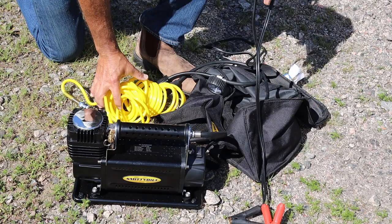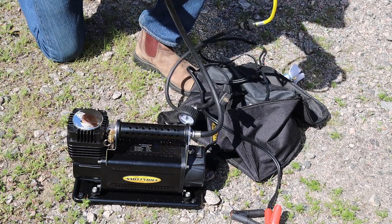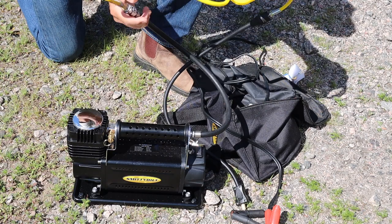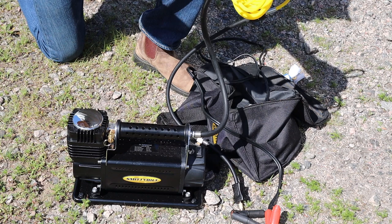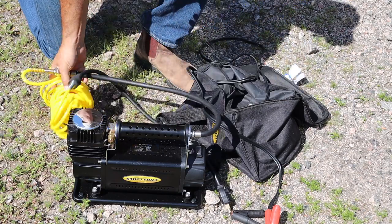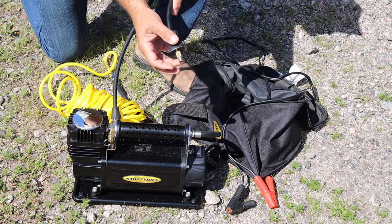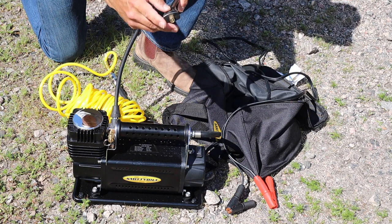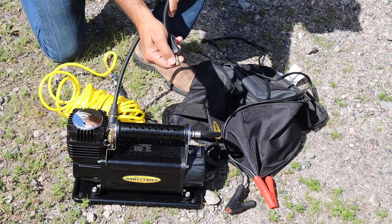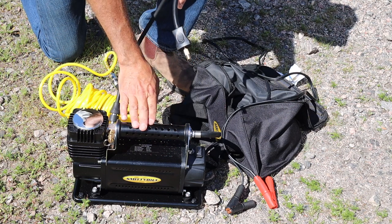Now here are the things that I'm concerned about. This hose that is provided is pretty flimsy, and I believe after a few uses it will eventually wear out. I'll have to replace it, and then I'm going to be stuck because the replacement hose will probably have a standard fitting and I'll have to change out the fittings. The other thing is that this unit gets extremely hot when it runs — when you want to take it apart you have to wait for it to cool because it's too hot to touch. The other thing is this gauge is not very accurate at all — it's actually useless. Also, the way this pump operates, when you turn it on the air is already passing through, so you attach it to the tire after turning it on. You don't attach it to the tire first and then turn it on, because you could blow the circuit or hurt the pump.